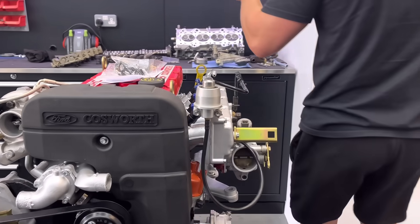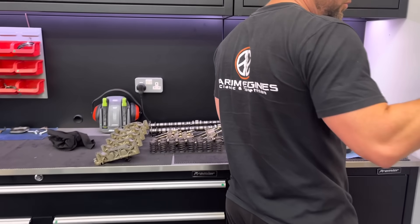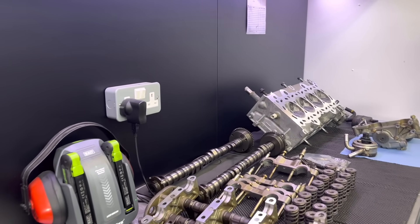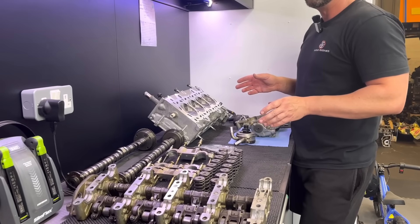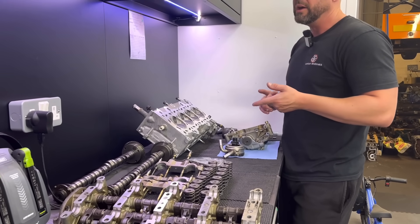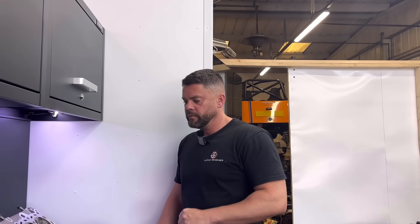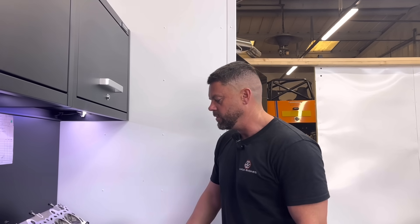And in its place we have got the Honda Civic Type R — one of them that was all lying about over there. We've got that all off the floor. So this was the one that had done an end — scrapped the crank, scrapped the rod. We've managed to get another crank. We are going to get a new one — well I'm going to have a word with the customer first. You've measured the rods this morning haven't you? Yeah — the one rod was completely and utterly knackered, and the other three were to be fair probably saveable, but we'd probably have to take a bit off the caps and size them and balance them. And by the time you've done that, it's under 500 quid for a brand new set of rods — ain't worth messing about.